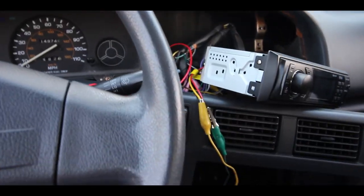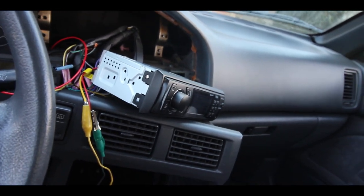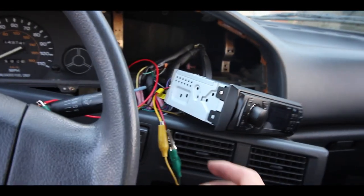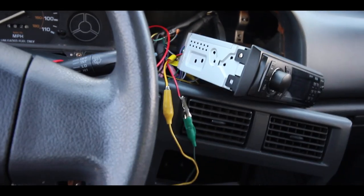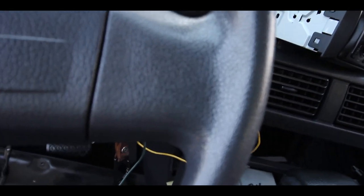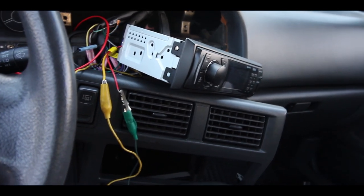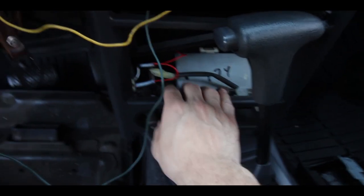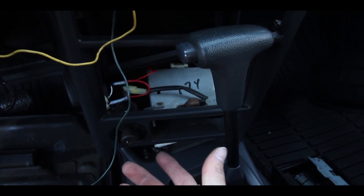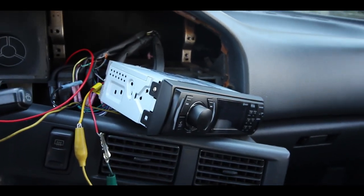After spending like an hour trying to figure out why it wasn't powering the radio and looking at all the wiring schematics online for this car, I figured out how to get the radio to start. I ended up getting battery constant power to the brown wire, and then for the ignition wire — I guess on some of these older cars they don't push enough ohms to send a signal to new aftermarket head units to make it start. So I ended up tapping the red ignition wire down into the cigarette lighter, because that has a 12-volt signal — so when the car turns on, this will turn on and turn the radio on. Now we can get all this wire nice and neat, shove it back in there, and move on to the speakers.